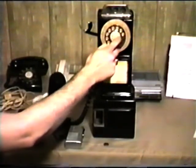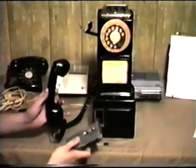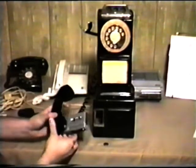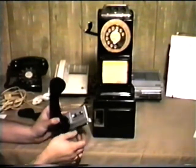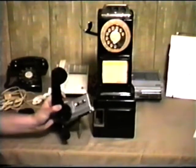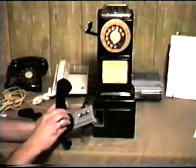He then punches in the long distance number of the place he wishes to call. The AX computer then comes on and tells him to insert the proper amount of money. Remember, we must insert one real coin. In this case, we will insert a nickel and then beep in the rest of the tones by using the cassette player. Holding the speaker of the cassette recorder up to the pay telephone receiver, we press play on the poor man's red box and play the quarter tones into the pay telephone.